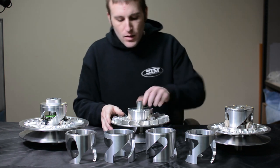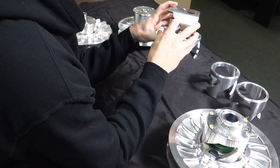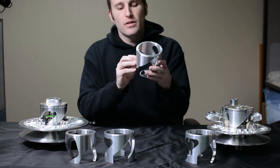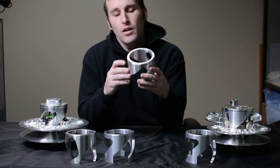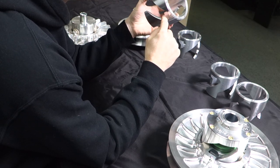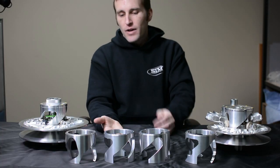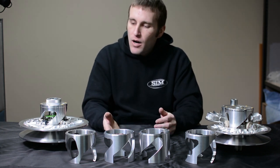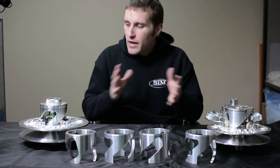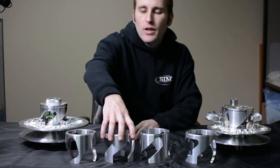With progressive angles like on a 35-45 helix, when we start shifting at 35 degrees we present a lesser load to the engine than at the 45 degree finish rate. The advantage is we can get the car rolling easier with less load on the engine, and then as we get vehicle speed up we can shift out at a faster rate to bring the RPMs down while cruising. A 35-45 helix will cruise at 40 miles per hour at a lower RPM than a straight 35 helix would. When you get back into the throttle while cruising though, it won't be as snappy because you'll be shifted out to a higher gear — that's the give-and-take in the secondary.